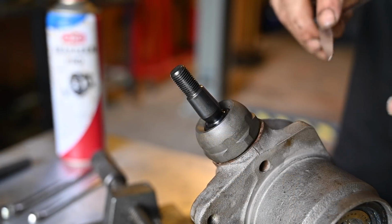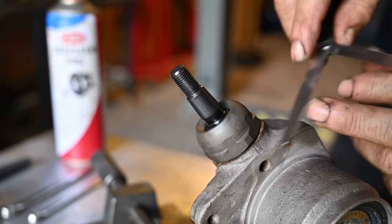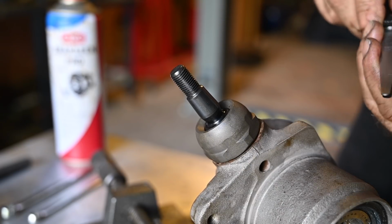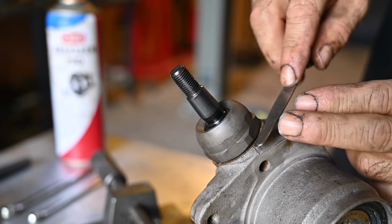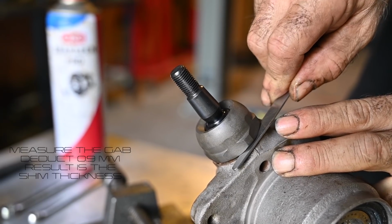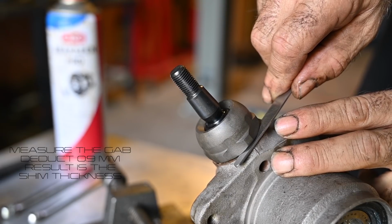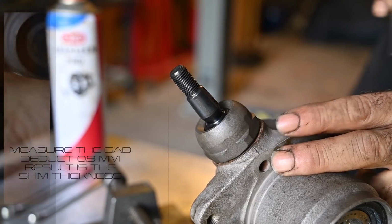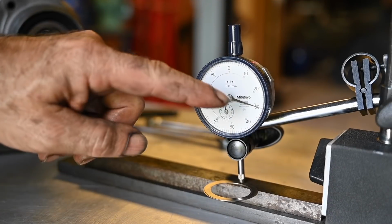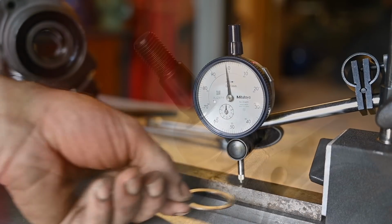So we use our feeler gauge and check. Now this is 1 millimeter. I'm going to give it 0.2 more. So I'm adding a second plate, and I think this is about right. So this is 1.2 millimeter. So I need to put a spacer up of about 0.3 mil. Two of those spacers together makes 0.3 mil. So now I can fit that one, and everything should be all right. So let's see.